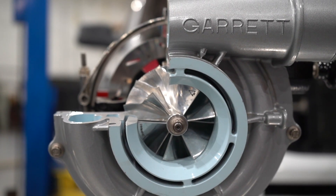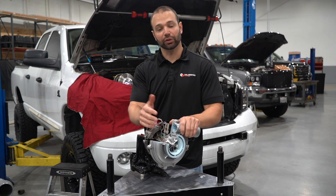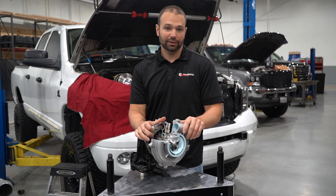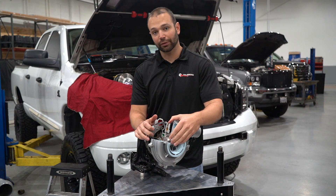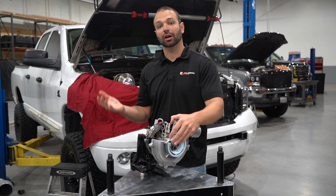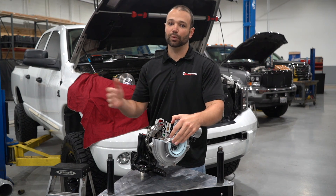One of the biggest mistakes you can make is oversizing the compressor wheel. The bigger the compressor wheel, the slower the shaft spins — and that's compounded when you have extra load on the front of that compressor. As load comes up on the front, it also slows the shaft down, which slows the turbine. When you slow the turbine down, drive pressure comes up. No matter what you do with the vanes, the slower the turbine spins, the higher the drive pressure. As drive pressure overcomes boost pressure, you get that upside-down situation — the turbocharger makes a lot of heat and you're not making the power you want. When you do it right, it's magic: you get the big turbocharger pushing a ton of air up top, keeping things cool, and you get all the spool-up benefit of that small turbocharger. The big turbocharger dictates how much power you can make; the small turbocharger dictates how well the truck spools up.